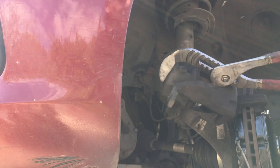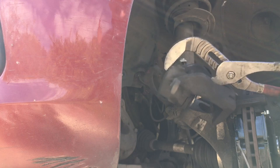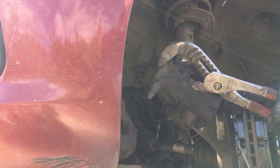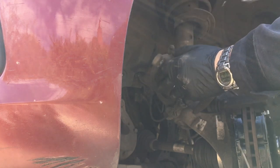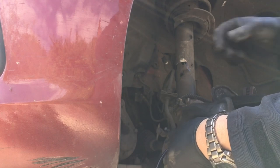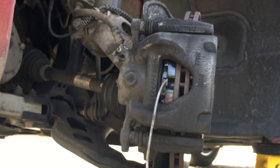Feed the new wire through after we've compressed the piston back again - slow and steady squeeze. It takes a while but it does go back nicely. There she goes - beautiful. We know we've got space in that tank because we checked it earlier, so the fluid can go back up into the reservoir. That's back far enough now to get it onto the caliper mounting over the brake pads. Feed that wire down and slide that back on again.